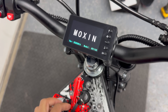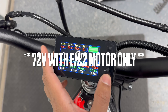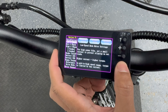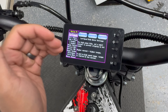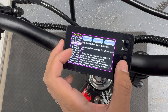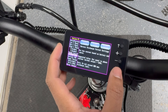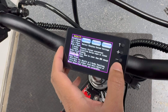I'm just going to quickly go over the tune settings that we ended up with for my exact setup. These settings won't work on your bike if your setup is slightly different — just use this for reference as a starting point. The rated current we have set to 200 — this is only acceptable because I have a Socion FW22 motor in place; I would not advise this if you are using a stock motor. Low G, mid G, and high G is like three different settings — think of it like eco, daily, and sport. The slowest setting I have set to 200 phase amps, the middle setting at 450, and the fastest setting at 700 phase amps. Battery discharge we upped to 225, which should be okay for short bursts since my battery has a peak discharge of 250.